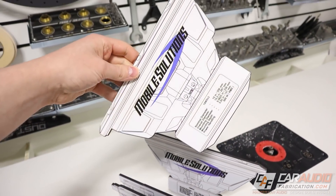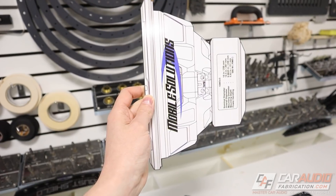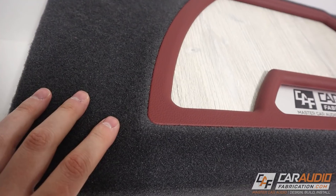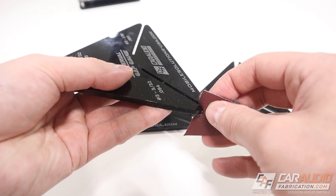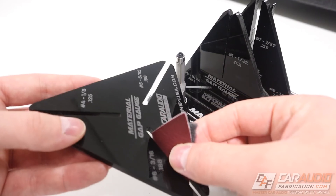Another good idea for planning is to use mock-up cutouts of things like subwoofers to ensure you're going to have enough space in the location you're planning on putting them. Another important aspect of planning — and I mentioned this earlier when talking about using routers to create gaps between different pieces — you want to plan for how you're going to wrap all your pieces with upholstery materials. This means leaving gaps and clearances between those parts so there is room for that upholstery to sit. Gapping panels correctly is really an advanced technique that gives your builds a very high-end look.